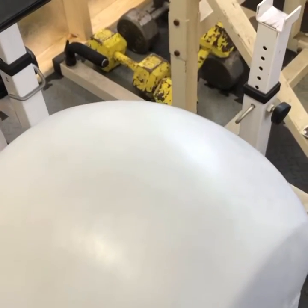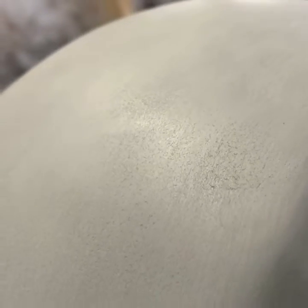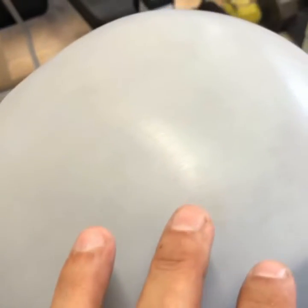The reason why we do the etching primer is, I did two layers of the filler primer, and you can see some areas where it's kind of cratery here. That's a perfect shot because there's filler in there. This happens sometimes when you put it on heavy, but believe it or not, it's actually super, super, super smooth, which is good. It's not rough or anything. This last layer of etching primer will completely fill this in.